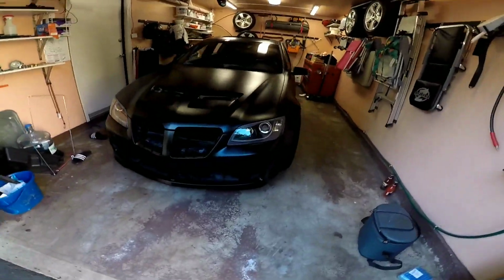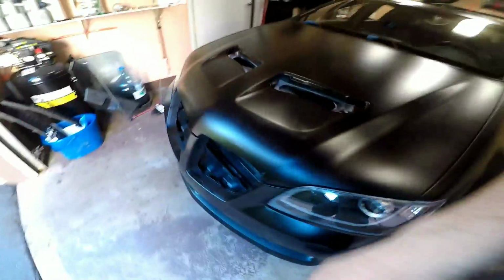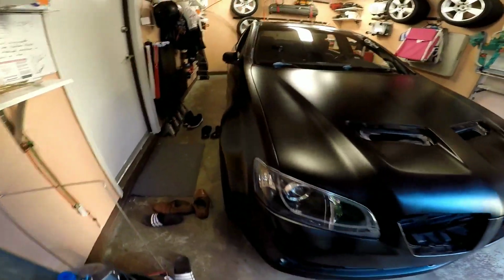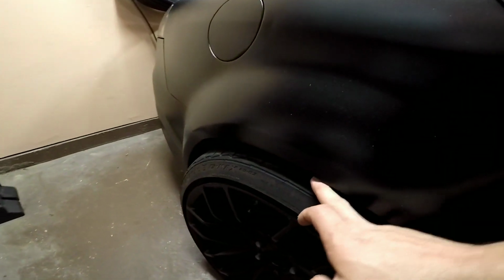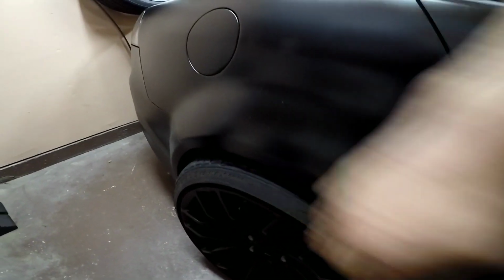All right, we are here, boys and girls. We're gonna jack up the car, get the tires off, so we can adjust the suspension. Gotta drop the front struts at least half an inch, and lift the rear by half an inch, because it does rub. So once we lift it, we'll stiffen it and we'll take it from there.